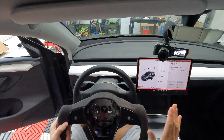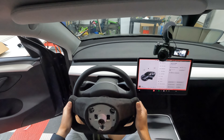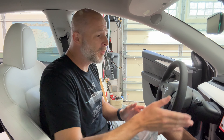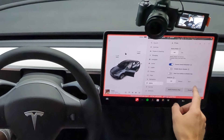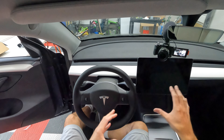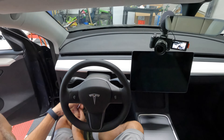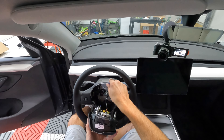You don't need much to do this. The new wheel goes right on here — it's a little wider than the factory wheel, maybe a quarter inch on either side where you grab it. Every time I wrap a car I have it in service mode. We're going to turn off the vehicle: go to Safety, scroll to the bottom, and power off. That's basically going to power off the autopilot computer. Now take the screwdriver, put it in the hole, pop this side, pop this side, and the airbag is free — the yellow is the airbag.